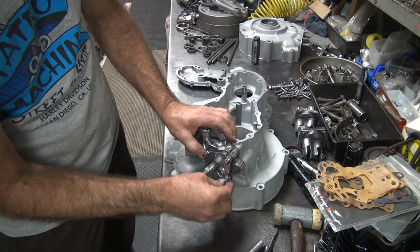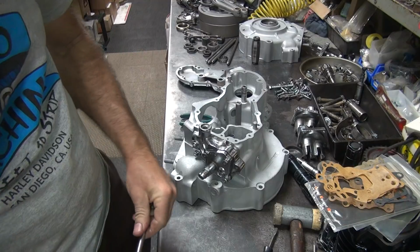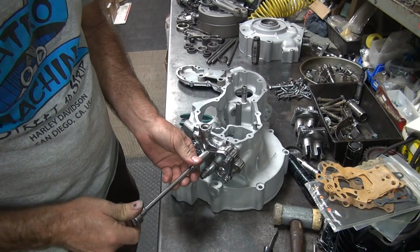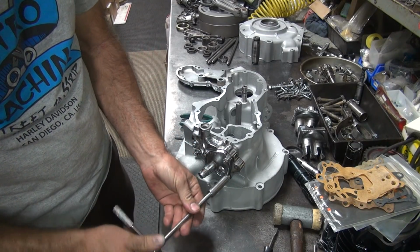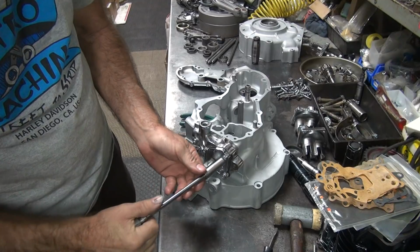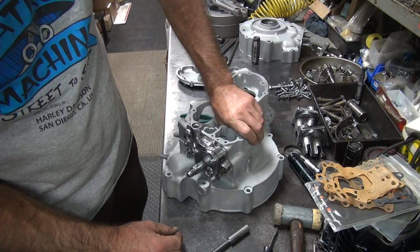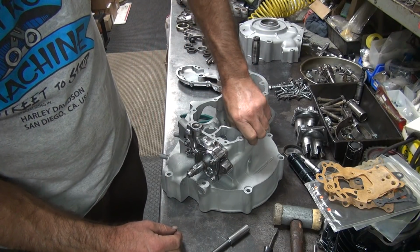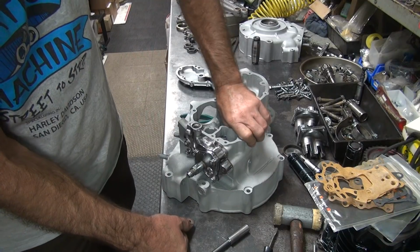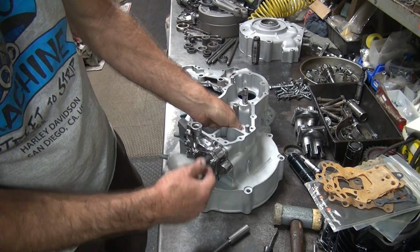And I wind up taking 2 thou off of each gear, just watch. Or this will be all bound up still and be some other issue because there's no way the gears will be hitting right now. There's something else wrong. Yep. Something else is binding this thing up because this is not the problem. We have a big gap on both sides of the gears.